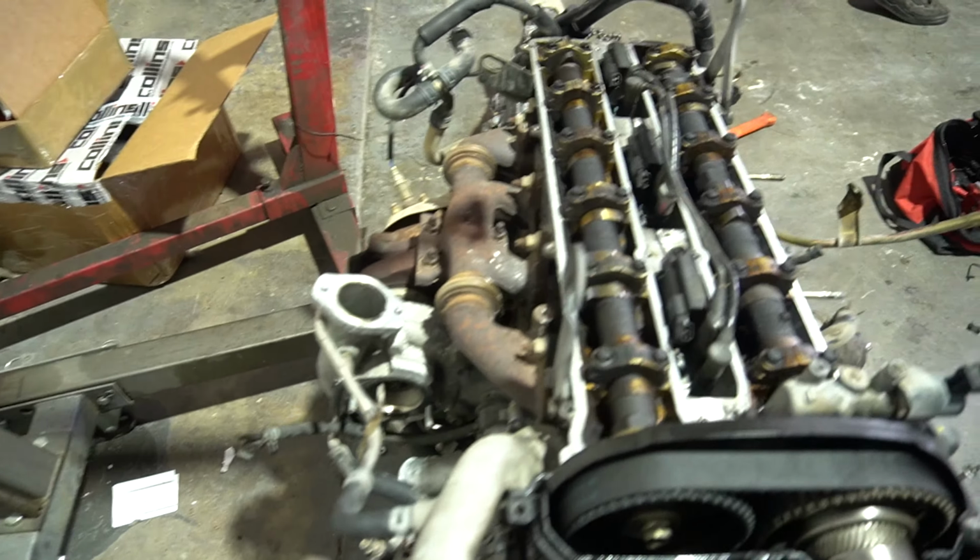The biggest thing, guys, like I told you, there's not a lot of forums or videos or basically any information as to what works and what doesn't work for a 1J to 350Z swap. The biggest thing is, well, we don't have a 350 in here, the firewalls and the sidewalls on the Z. They're pretty close. It's kind of weird to show you guys because we don't have the Z here, but it's really close. And what we're scared of is that this might hit that wall on the engine bay and not allow anything to fit. So we're running a CX Racing manifold, and we're gonna see if this hits or not.